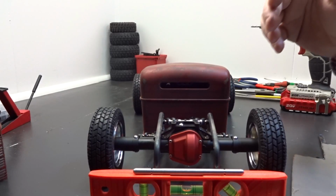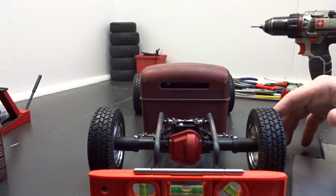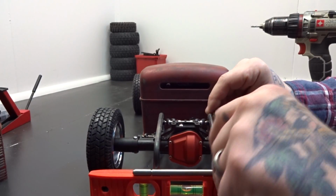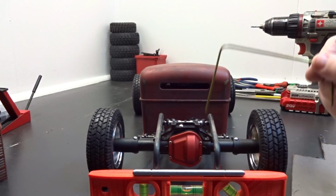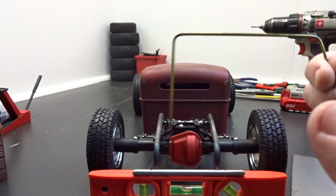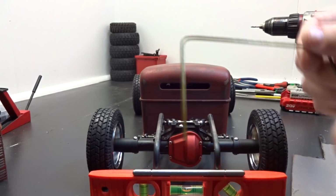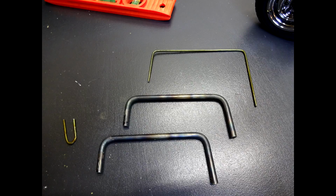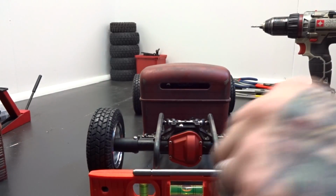All I did was take some 1/4 inch solid round bar and bend it. Well, what I did first was take a coat hanger and start playing with it until I got the shape I wanted that resembled the back half kit that I saw online. Once I was happy with it, I heated up the round bar and matched it to my coat hanger. The coat hanger was basically a stencil. I just heated up the bar and kept matching it up to this till I got this.